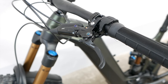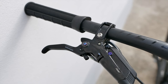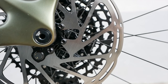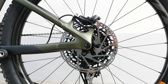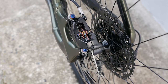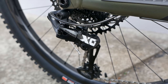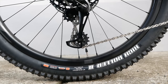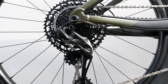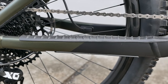The brakes and gears are in no way inferior in terms of quality. With the SRAM Code RSC and its four brake pistons, you always have control on the trails. 220 millimeters at the front and 200 millimeters at the rear means you can push both brake discs to the limit without worrying about reliability. The shifting components from SRAM prove equally perfect for uphill and downhill. The single drivetrain with 12 gears is now almost a must on such a bike, and the cassette range of 11 to 50 teeth covers everything you need off-road.